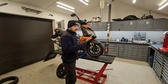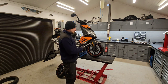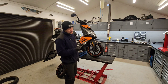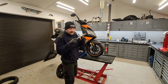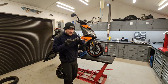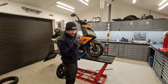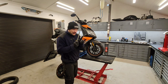Another thing, wheel axles. Clean them. If they came out easily, clean them with the paper, put the grease on them a little bit, not too much. Don't go crazy. Nothing moves on that one, okay? Nothing spins on that one. The inside part of the bearing sits on the axle, but the bearing spins. Nothing spins on the axle, so don't go with the grease all over. Nothing is moving around the axle. There are bearings to do that.